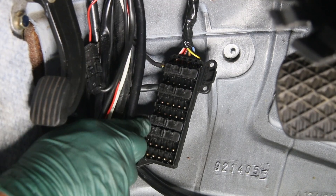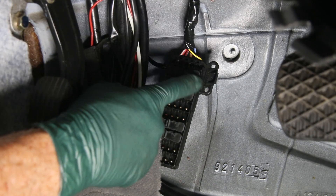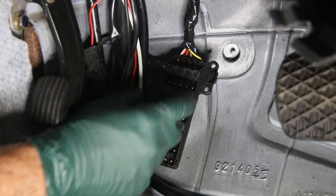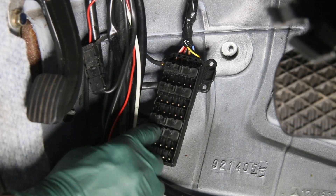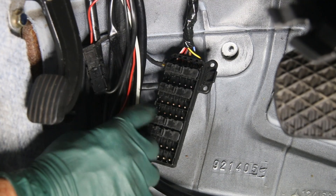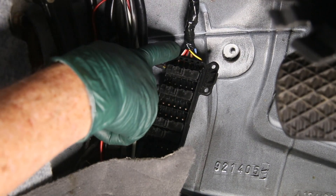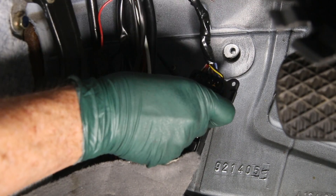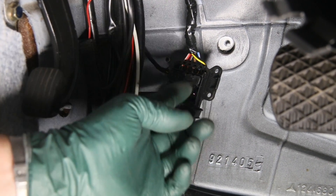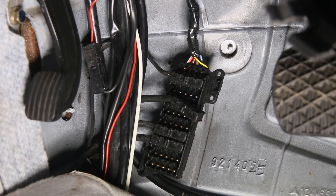There it is — you can see there are four plugs that come into it. Look at that red and white wire right there; that's the main wire coming from fuse C. Any of these circuits can cause problems. One thing you can do with this terminal block is start unplugging these one at a time until the short or drain goes away, because this allows you to isolate the area in the car. These feed multiple things like dome lights, radio, power antenna, and seat belt retractors on the coupes. You may need a wiring diagram, but this is a really handy way to isolate problems in what I consider one of the more common circuit problems in the W124 chassis.